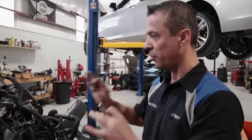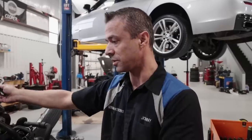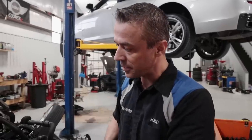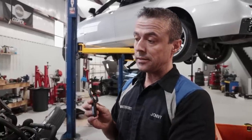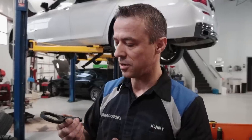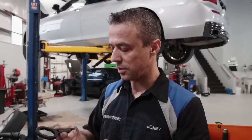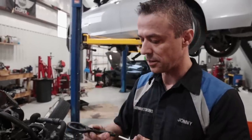We have to remove the cams on this side — I always start on this side, just force of habit. But before you do that, make sure the engine is on time. It's up to you what you're going to do, but do not buy those Amazon or eBay timing tools. Get the right one, which is the AGA — it's pretty much triple the price but it's worth every dime. It's a much tighter tool, it times so much better. I bought the Amazon one and did not like it; I tried it once, pushed it to the side. Get the right tools.